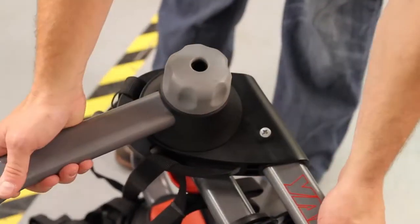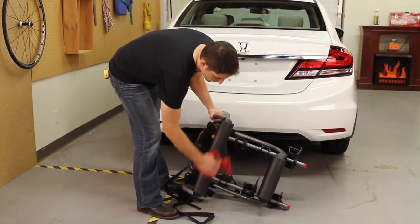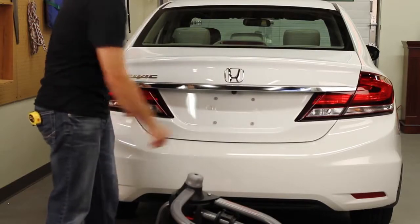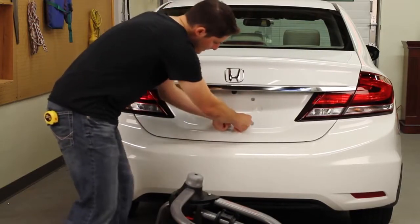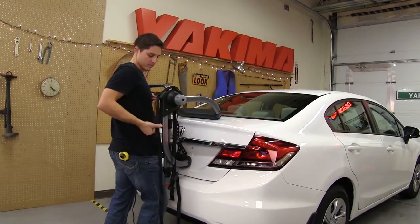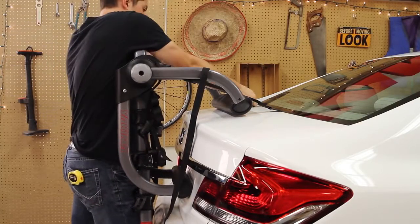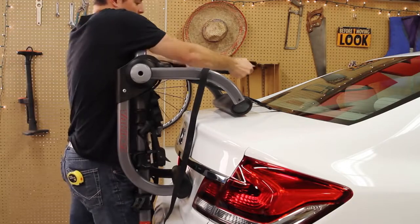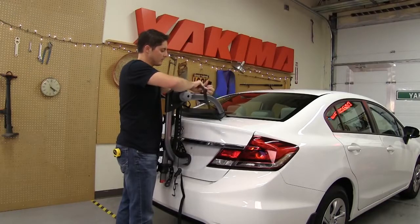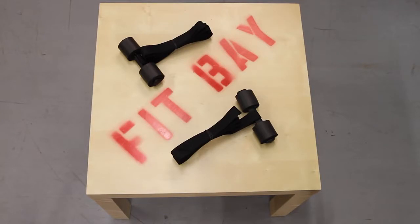Now just tighten everything up. Let's mount up. First, make sure both the rack pads and any contact points are nice and clean. The lower support is going to carry most of the weight, so make sure it's resting on a well-supported location. The license plate depression is a common spot that's often got what it takes. Run the top strap hooks over the frame and attach to the top edge of the trunk lid, hatch lid, or rear door. Tighten the straps so the hooks are parallel to the body of the King Joe Pro. If the hooks don't fit in these spots, alternate attachment methods using the included glass hatch hooks are covered in the full product instructions.